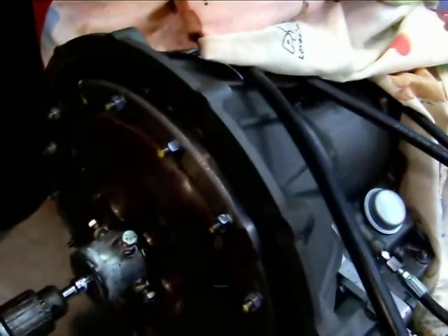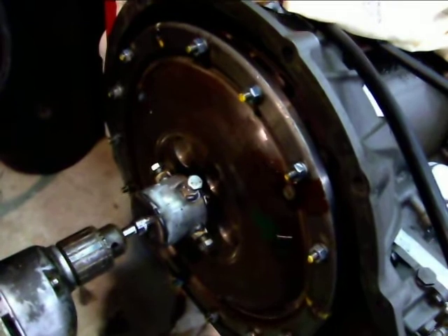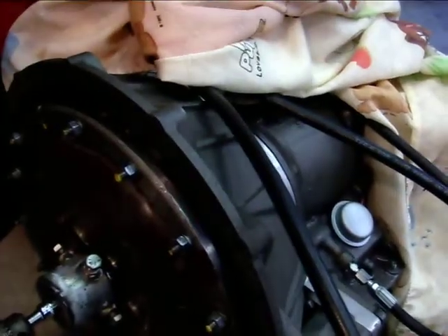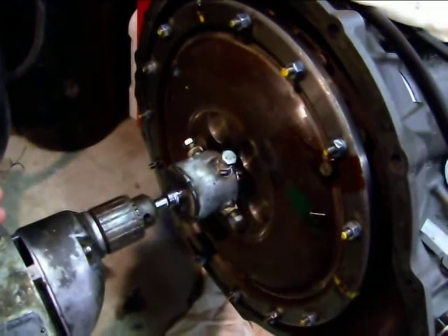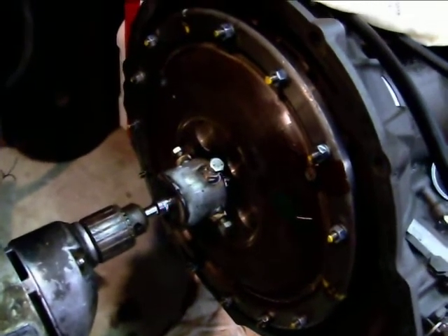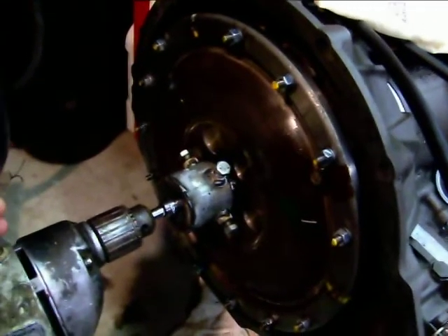I do get shaft rotation. You can tell low from high because of the speed difference, and you can also tell when you kick in the stator. When you hit reverse, the shaft turns about a turn to a turn and a half and then it stops. There's just too much friction and I'm not going fast enough — 300 RPM is really not going to produce much movement of that shaft.